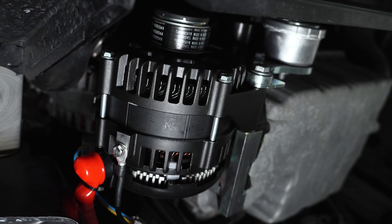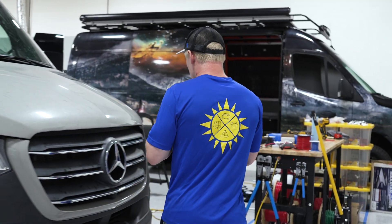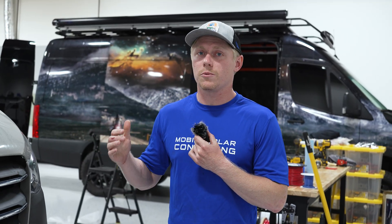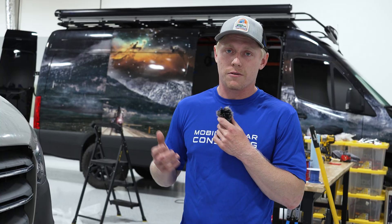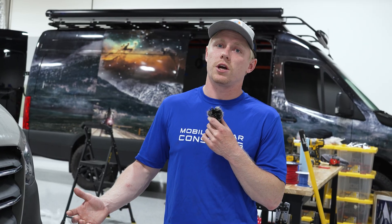Potentially the biggest upgrade of all is the secondary alternator. We've got a 48-volt alternator mounted on the vehicle, and that's going to allow the customer to charge at up to six kilowatts. They've got about a 10 kilowatt-hour battery, so put the math together — that's recharging from zero to full in under two hours, which is insane for alternator charging. The part that couples with the alternator is the Mid-City high idle kit and remote start. That's underneath the steering wheel, and it's going to allow the customer to idle at high RPMs so they can charge quickly while parked, but also it's going to allow the Victron system to remotely start the car if the batteries get low and need a charge, just like an autogen start would work.